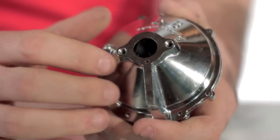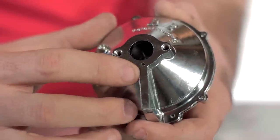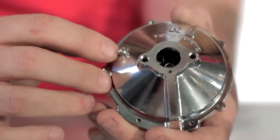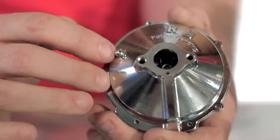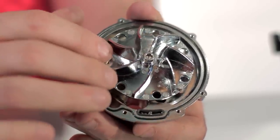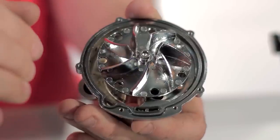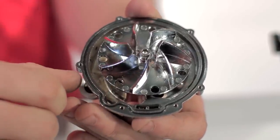This is the backside of the supercharger where the carburetor mounts directly to the housing. You can see here the vacuum pickup line for your fuel pump. We've also got the nitrous nozzle built right in — so if you want to inject nitrous into your fifth scale engine, you plug it directly into this fitting. This is the internals of the supercharger: this is the high-speed fan that's dynamically balanced for high speed. As you can see, it's totally sealed with an O-ring, both for the vacuum line as well as the outside of the housing.